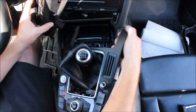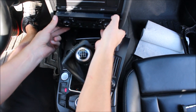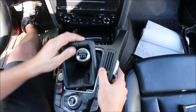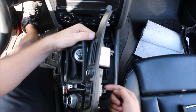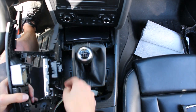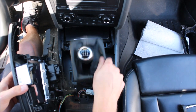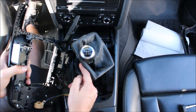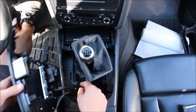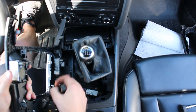You can see there are some little hooks here that were tucked in behind this. Once you have this pulled forward, I like to just put it back in because it keeps it out of the way. If you still have your boot attached and decided not to do the risky way, you can go underneath with some screwdrivers and hit these four tabs to get it loose. Then you turn it over and find the wires — you might have to undo the wires first. You've got three clips here. It's optional if you want to take these off — you do risk scratching your trim, so I like to just take it off and get it out of the way.